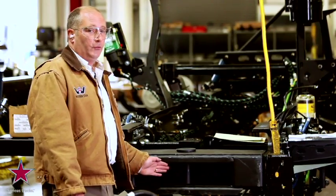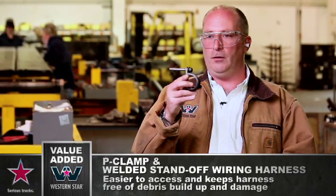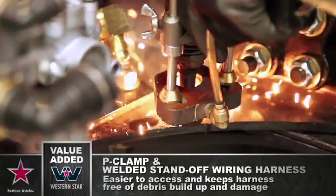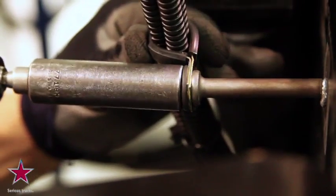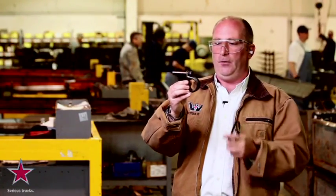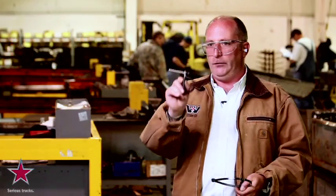Here's how Western Star holds up their looms and harnesses on all rails on all models of trucks. We take a steel standoff that is threaded on the end and weld it onto the frame or cross member of the chassis. Then we use a rubber-coated, steel zinc-coated P-clamp with a steel lock nut on the outside. The Western Star system holds the harness away from the frame by a large amount, so when road salt and dirt pile up on top of the harness, it just falls away. These are still going to be on your truck 30 years from now.